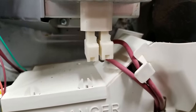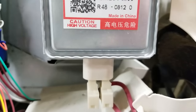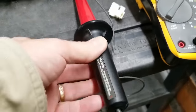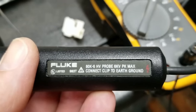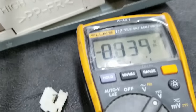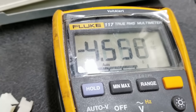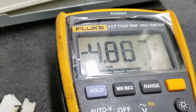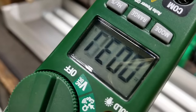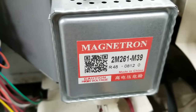Getting some humming out of the magnetron. This is an inverter microwave, so it just has this inverter circuit down here as opposed to a large iron core transformer. It just shut off again — it knows there's a problem. The water hasn't heated at all, still as cold as when we started. I'm going to very carefully open one of these connectors and grab a high voltage probe. I've got my Fluke high voltage probe here, rated 6kV peak max. Hit start, lightly touch the probe on there — we're showing 4,400 volts, bolting on and off, 4,500, 4,400. The inverter is starting and stopping, that's why we're seeing the current change from 3 amps down to 0.4. At this point we can safely say we've got a bad magnetron.